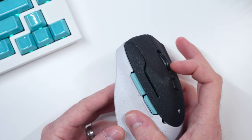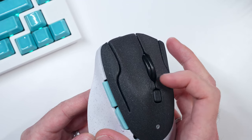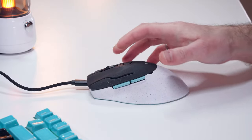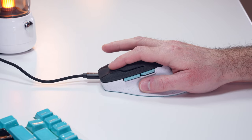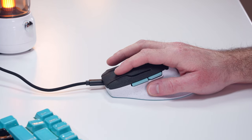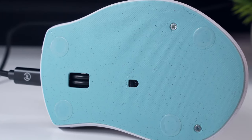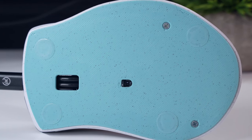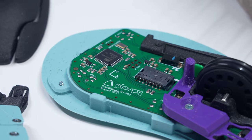The scroll wheel is a free-floating, optically-driven mechanism, so there isn't any ratcheting sensation, and the smoothness of the scrolling may be initially tighter than expected depending on how the 3D printed tolerances work out. The Ploopy Mouse is also wired, not wireless, which has taken some getting used to coming from mostly wireless mice for the past decade, but the benefit is that it polls at 1000Hz. It also uses a quality PixArt PMW3360 optical sensor capable of being configured up to 12,000 DPI via the QMK configurator. The company has also made a DPI toggle available under Custom Actions in VIA to jump between 1200, 1600, and 2400 DPI settings, though I haven't been able to perceive much of a difference when using it on the Ploopy Mouse.